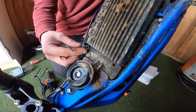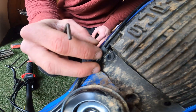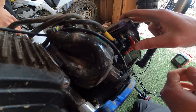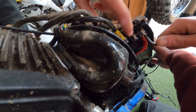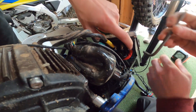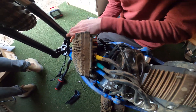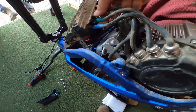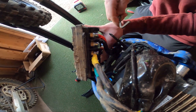While Kyle was taking this apart, he noticed that this clip actually gets held in by that bolt — so don't miss that when you put it back on. After you flip the controller upside down, you can see underneath you have these connectors that you have to take off. They're all fives — five millimeter Allen key. These two go to the battery, and these three — yellow, green, blue — all go to the motor. The red and the black go to the battery.